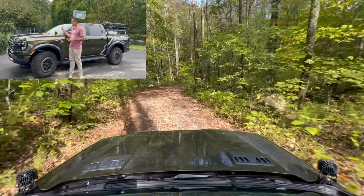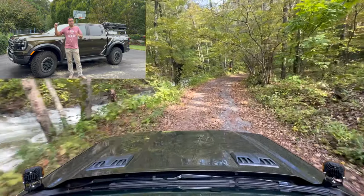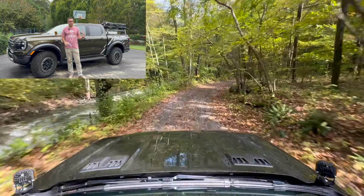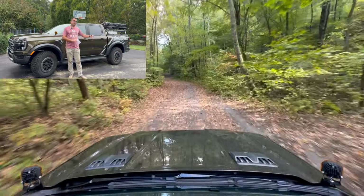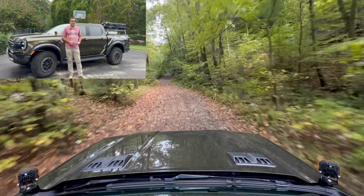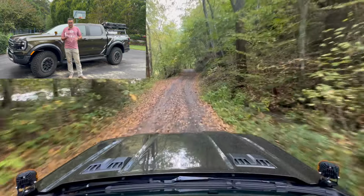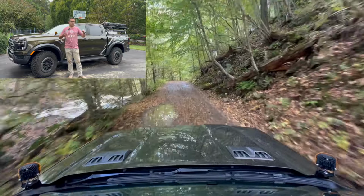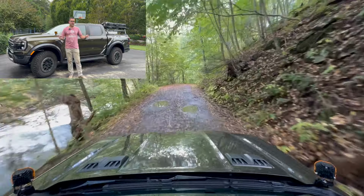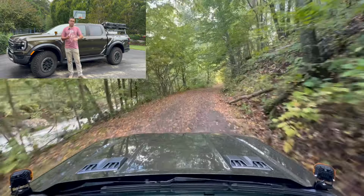And the density altitude is different from when I did those 0 to 60 runs back in the March, April time frame. It was like 40 degrees outside and very dense, dry air. When I did all the 0 to 60 runs today and yesterday, it was in the 80s and humid, so density altitude is a lot different. Density altitude takes into account the altitude that you were at. We're about 300 feet above sea level here in Haymarket. It also takes into account the temperature, and the humidity or density of the air.